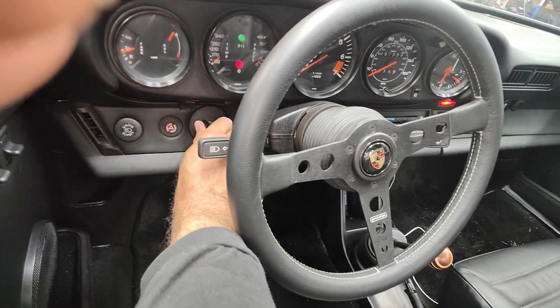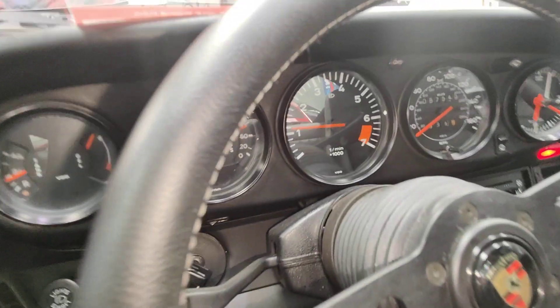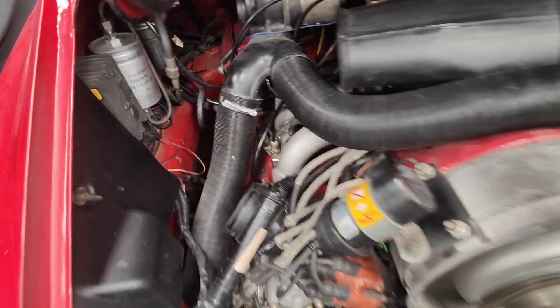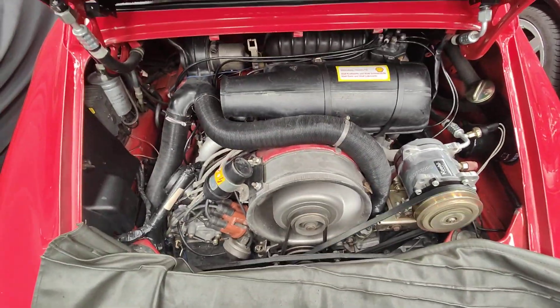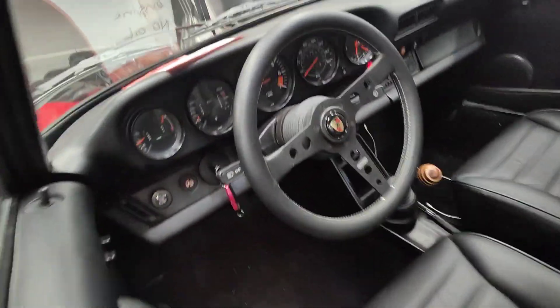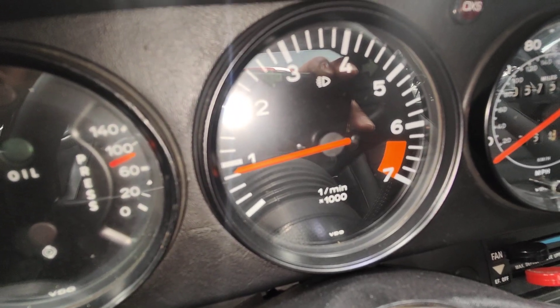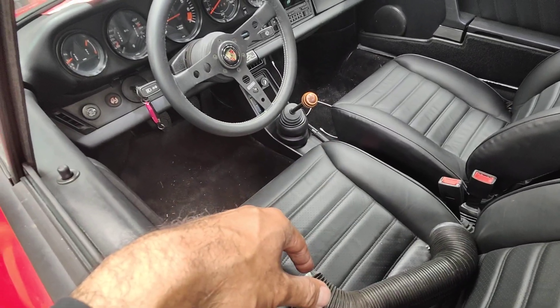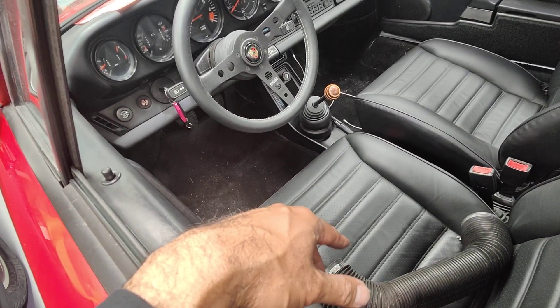Let's have a look at the gauges — beautiful, look at that! After nearly one to one-and-a-half minutes, the rev counter dropped down to 900, just like that. So it is working properly. The warm-up regulator pumps up the idle to around 1,400–1,500 RPM depending on the adjustment, then slowly works its way down as the engine gets hotter.